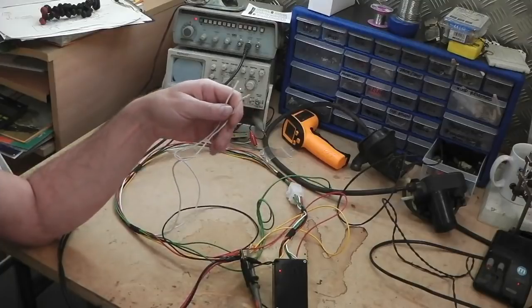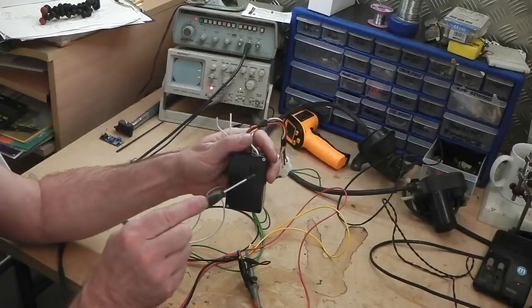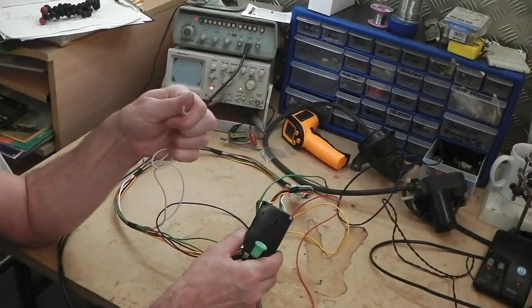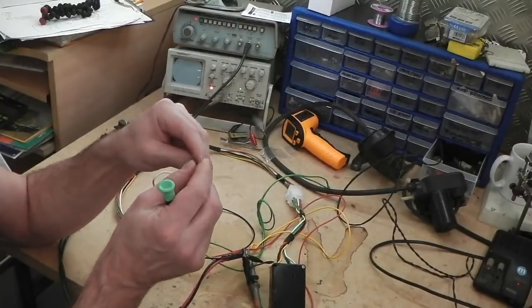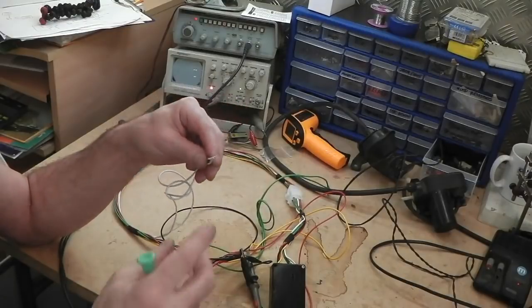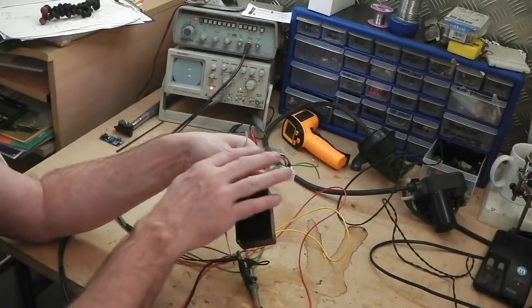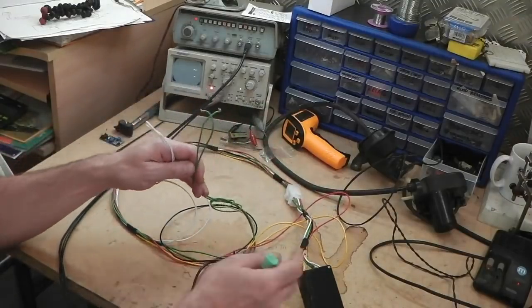Okay, that's it. So, to summarise that, the little tiny relay that comes on with this red light does not directly activate the lockup solenoid. It simply closes these two white wires together when all the conditions are correct. Those two white wires, when they close together, there'll be a separate relay behind the dash, or it could even be bolted to the gearbox if you want. It'll click on, and that then fires it. So that means you're keeping this isolated away on just the low current side of things. That's it really. So don't worry, because there's not that many cables.